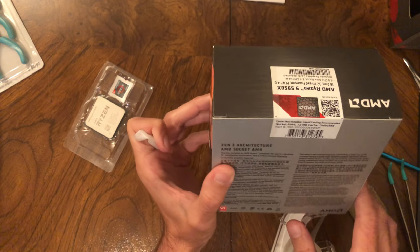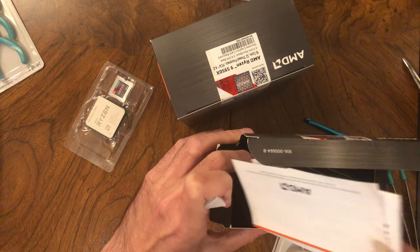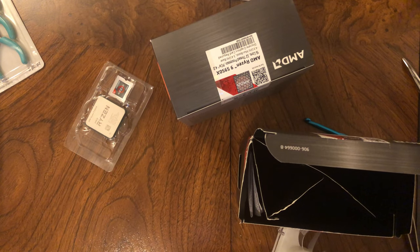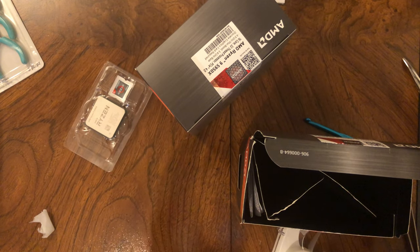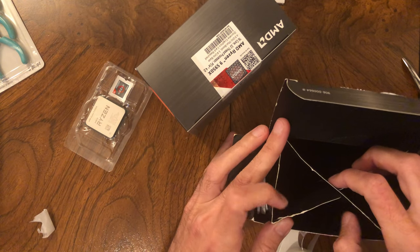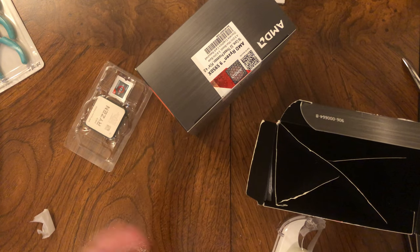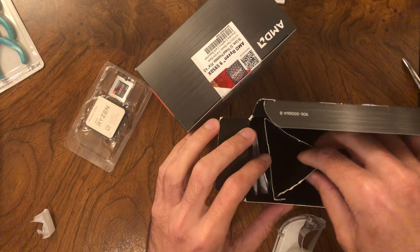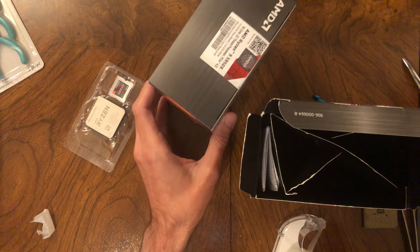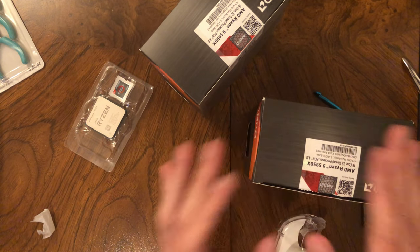For AMD, I think the main vulnerability in this package is this spacer thing. Previous units would have a cooler, I think, here, and that would occupy enough bulk that you couldn't really manipulate the chip out of its inner package within the outer package and then slip it out through the gap in the outer package. That's a problem. Simple improvements could be to replace this paper auto bracing thing with some kind of solid, maybe a solid piece of styrofoam. That would prevent this method from working because you wouldn't be able to manipulate the outer package within the inner package, or the inner package within the outer package. There won't be enough room. That's probably why this packaging worked fine for previous versions that had a cooler, but for this version, it's not good enough.